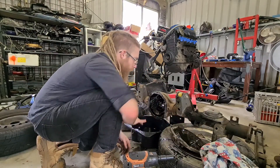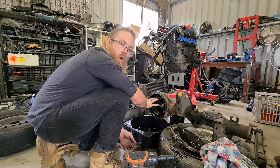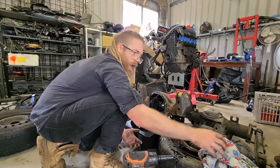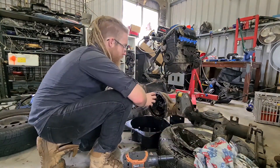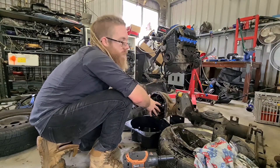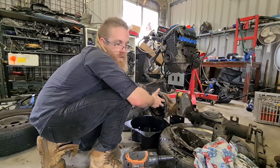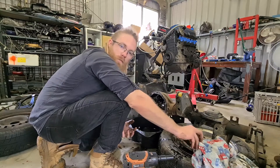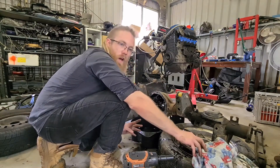Sometimes it's not an option — like I had to put a different center into my car, I winged it and it worked out fine. But just remember to try and match the shims to the housing and remember what side they come from, and you shouldn't have an issue with having to go get everything clearanced. I'm all about doing stuff myself and not having to pay a shop to do it for me, so just remember where everything goes.